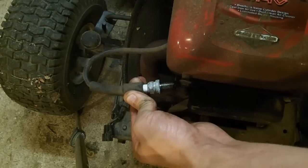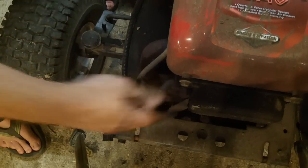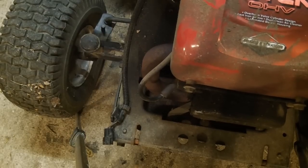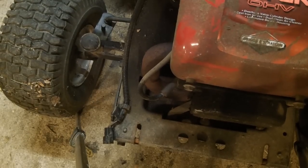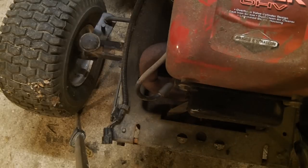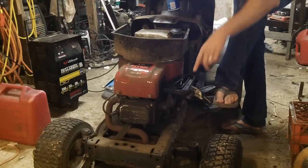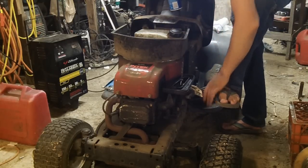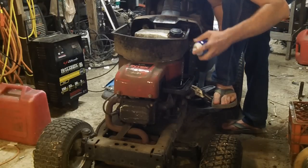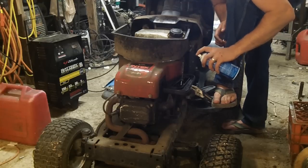All right, let's figure out what's going on from here. Let's try it again — 55 cranking amp, pedal down, going to give it full choke. All right, we almost had fire. My bet would be that the carb is probably flooding out. So what I've done is deliberately cleaned up and dried off the entire spark plug, and I've clamped off the gas going to the carburetor. So right now if it fires, it's on any residue in the carburetor. I've got starting fluid here to see if it will stay firing — that tells us it's the carburetor having issues, most likely a dropped float or a needle valve stuck in the open position.